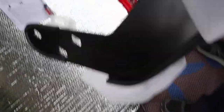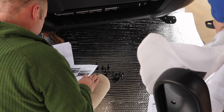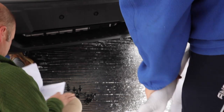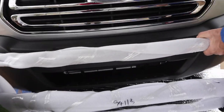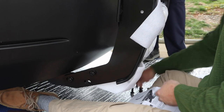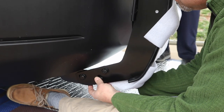Taking off that piece of protective rubber. It's time to put on the center guard. Is it going on the inside or the outside of the bracket? The brackets go on the inside. Pull that up with the two bolts in there. You've got three bolts on each side, with the guard going on the outside of the bracket.